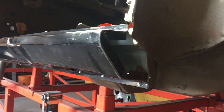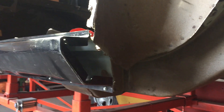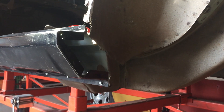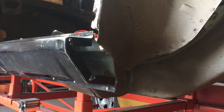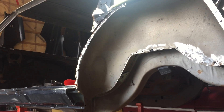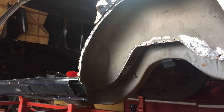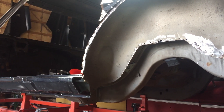I put the quarter panels on and there was a bulge right there — if you look down the side of the car you could see it. I knew that couldn't be right. So I cut it off — I did one side, living in Edmonton, bought another panel, put it on, and in the process I actually took that wheelhouse and pie-cut it. What I did was cut it off, put another wheelhouse on, pie-cut that one so it fit right in with the inner rocker, and then put that quarter panel on.